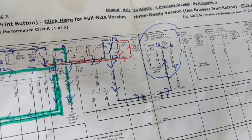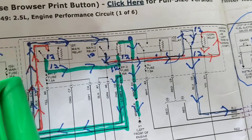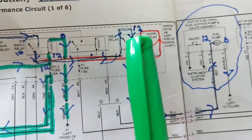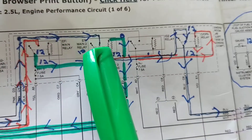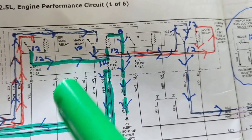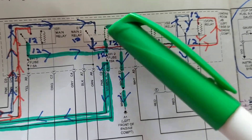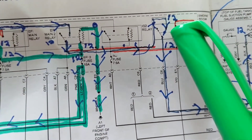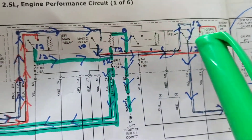You would not know this unless you pull out the schematic. You would only think one relay is involved, but no. The current path goes through this one, then this one — that's two relays. However, in order for the first one to be turned on, this side has to be energized. In order for current to flow through the second, this one has to be turned on. So these two control relays turn on the other two load relays.